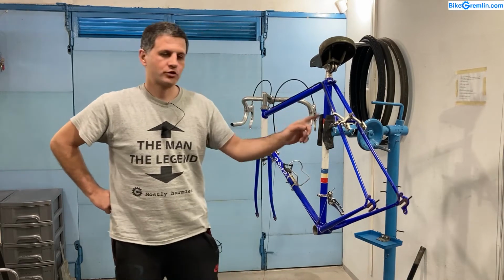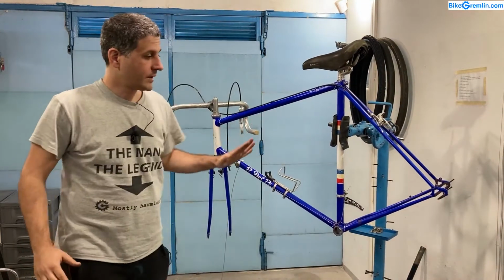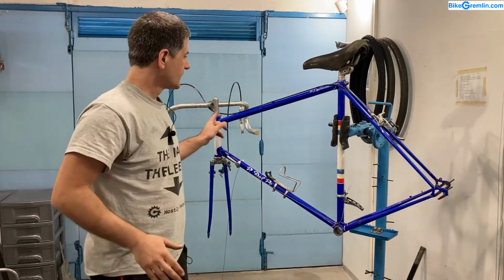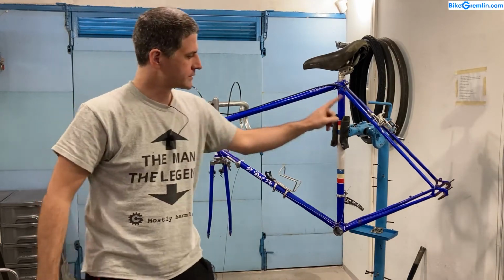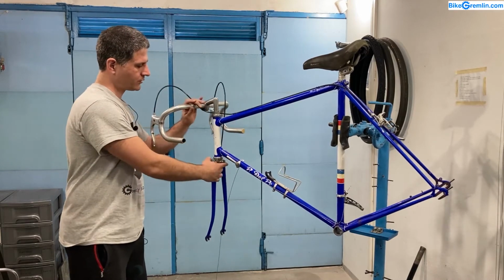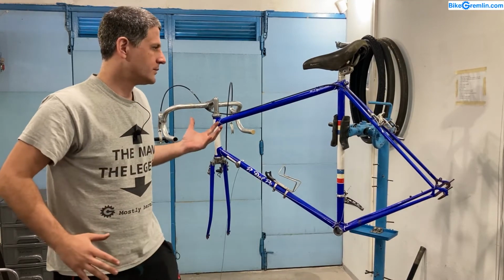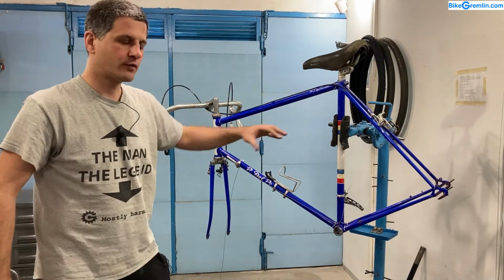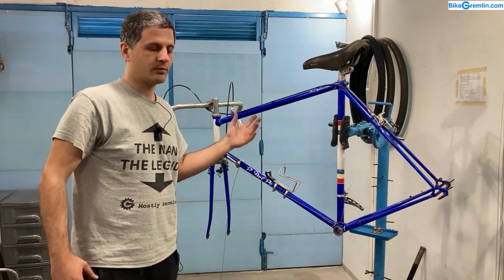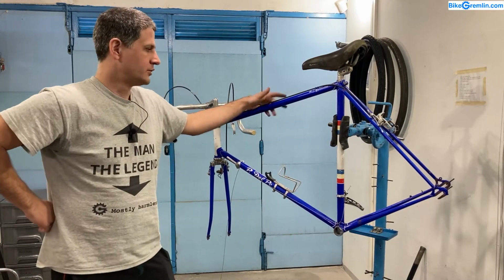And now, why did I recommend a cheaper, more simple bicycle? I'll try to show it using this. Okay, here we have a bicycle frame, and you can see like two triangles. This one has this section, but that's necessary in order to hold the fork in place and make it more rigid and stable. But the bottom line is that this structure allows for the strongest and stiffest possible frame with the lightest and thinnest possible tubes used.